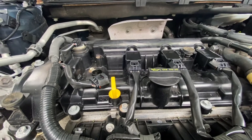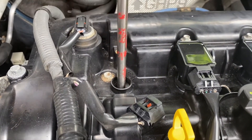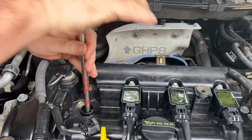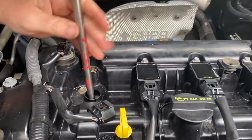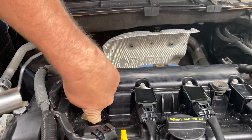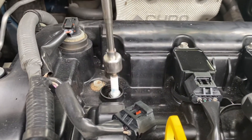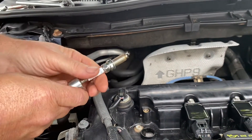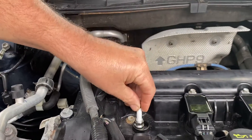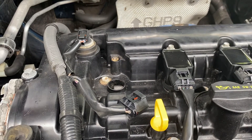The spark plug is underneath the coil. It's a different type of spark plug — you're going to need a 9/16 socket. You'll probably need a little magnet to get the spark plug out, and it comes right out. When you put the new ones in, make sure they're properly gapped. For this engine it's 0.044 inches. Don't drop them in — hold them with your finger until they pretty much hit the bottom so you don't change the gap. Then just reverse the procedure.